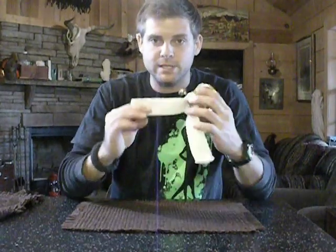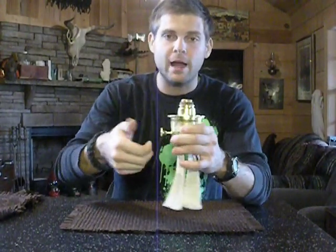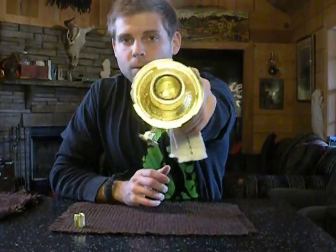Now, you would have a new wick in your hand that you could put in here, but I only have this brand new wick that's in my lamp, so I'm going to show you how to change it with this one. First off, you want to make sure your key is turning freely so that your wick goes up and down. You want to turn your wick down to where it's out of sight, and you want to grab your flame spreader and pull gently while twisting it until your flame spreader comes out. Now you want to grab the whole inside assembly and twist to the left — counter-clockwise — until you feel it disengage.